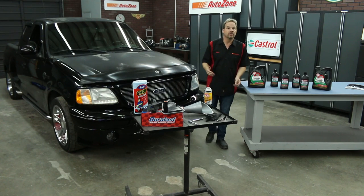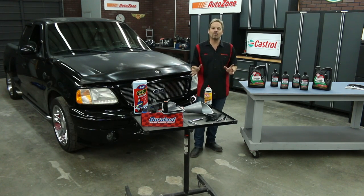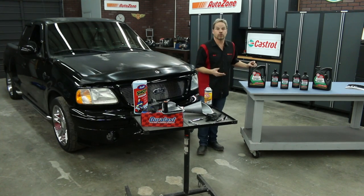If you don't have a manual, no problem. The folks at your neighborhood AutoZone can look that information up for you. To do this job, you're going to need transmission fluid. For this particular vehicle, the dry capacity is 18 quarts. However, for just doing a filter and fluid change, we only require about 12 quarts. Your transmission might be different.